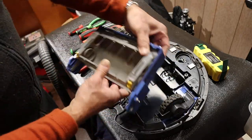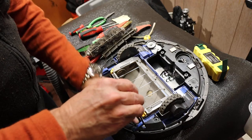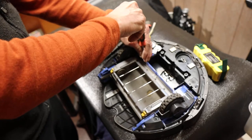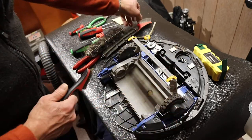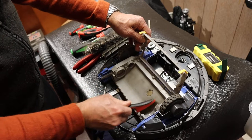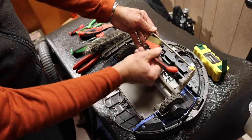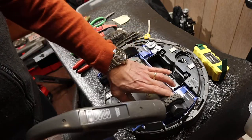I take the brush module, drop it back in, get your screwdriver. Once the module is in, I usually take the brush and scrub down the contacts — there are a couple of contacts on it I want to make sure are clean. I'll use the brass brush; I may use the stainless brush if things are really dirty, but brass usually works pretty good. You can also pop this front bumper piece off if you need to get up underneath — I just worry about those connections not lasting very long if I remove it repeatedly.